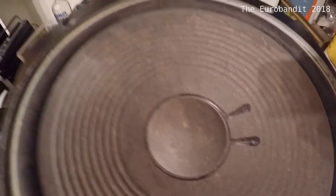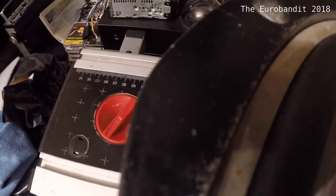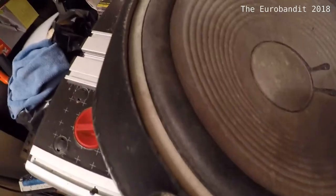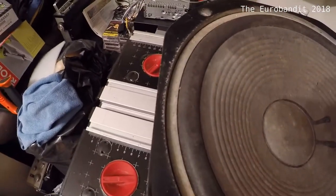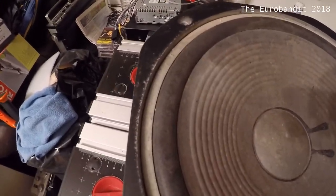You can also use acetone to remove paint from the edges if your speakers got painted, just like these ones. It really depends on what kind of paint it is — wood or metal paint or whatever. If it doesn't come out with acetone, then you might want to use paint thinner. If paint thinner doesn't work either, then your only option left is wet sanding the edge of the speaker. Fill up a small container with water, cut a small piece of sandpaper, dip it in the water, and just work your way through it. As more residue builds up, take a paper towel and wipe it off.